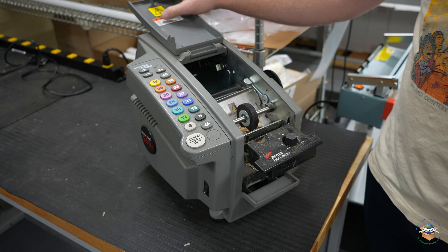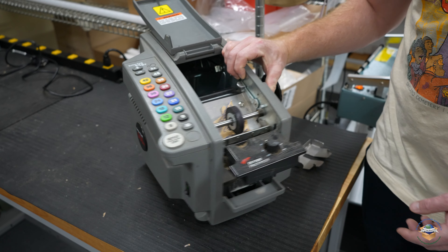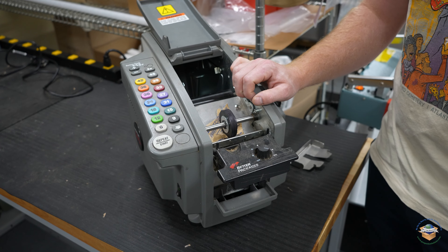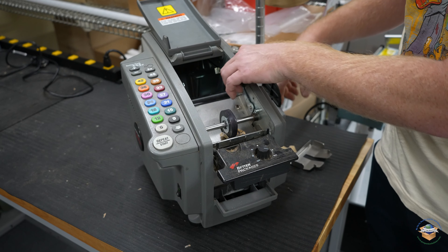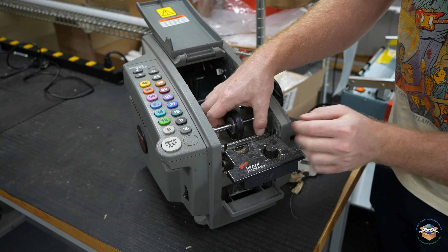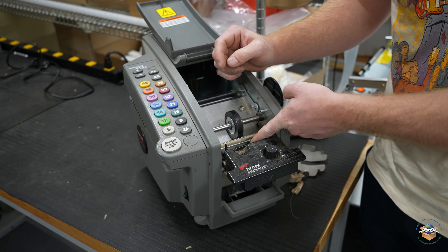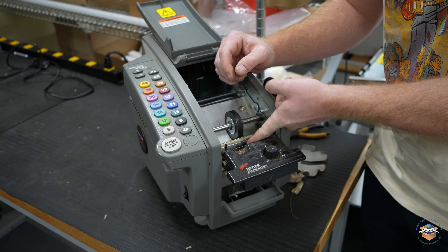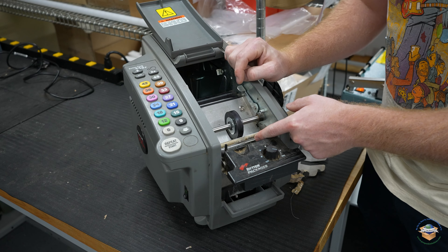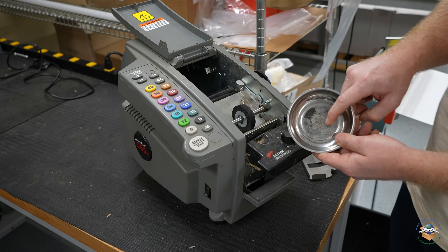We just got this 555 in for repair. It's typical when these machines come in there'll be some tape jammed, maybe missing a couple parts — especially when you have multiple machines, operators may go around and pick the bottle off, pick the tank out. That's what happened to this one. First thing I'll do is work on clearing this jam — may need to lift this, grab your needle nose pliers to help get some of this tape out. Before I've even gotten that far into this machine, I noticed this blade moving up and down. It's normally a spring that holds this blade down, and I'm willing to bet that spring is broken. Still, we're going to dig into this machine, fix that spring, clean everything up. I recommend one of these magnetic trays to hold all your screws.